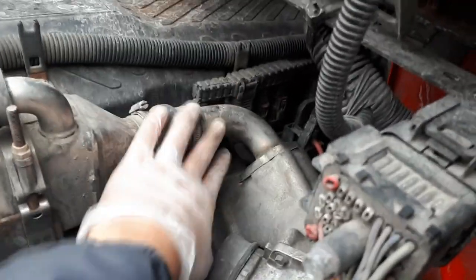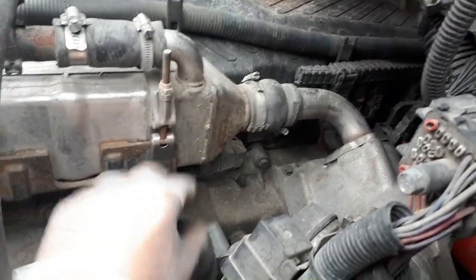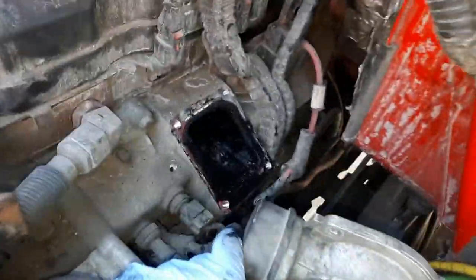Right now I want to take off this tube and see if it's moist inside. If it's moist inside, you know it's definitely leaking — and that's not a good sign. Look at that. Inside the EGR cooler I found this. It feels like tar. It's supposed to be dry. If it feels like tar, it's because it's mixing with moisture.